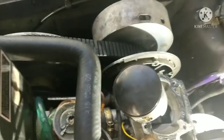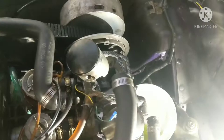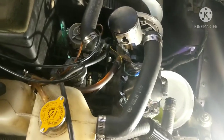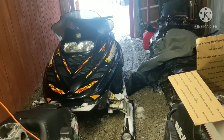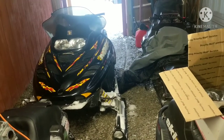It was doing about 3/4 throttle, kind of just bogged a little bit and just died. So I thought it was the plugs originally, switched plugs, nothing, made sure the kill switches were up, nothing, had good spark and all, still nothing, and brought her home. We towed it all the way back with the MXZ 500, towed it like a champ. We had to bring it through a creek, did get stuck there, but once we got it out of there, it towed pretty good.